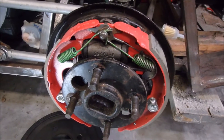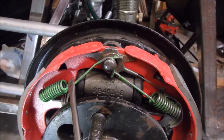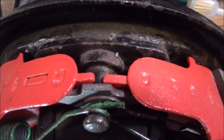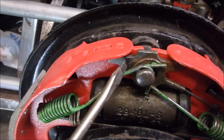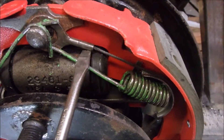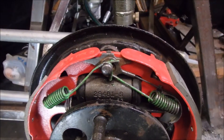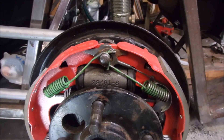When you get the shoes lined up, there are protrusions from each of the shoes that go into the slave cylinder. You'll have to push the two shoes in with your hands to compress the slave cylinder, and make sure the tops of the shoes are engaged evenly on this lug here. In behind it, to help hold the shoes in place, is this little metal plate. And then on top of that goes the end of this little cable here. Then, and only then, can you start putting the springs on. Of course, everything's going to try and come flying off as you're doing this — it's a bit tricky, kind of like patting your stomach and rubbing your head at the same time. It can be done; it may take several tries. Don't worry about tensioning that cable yet.